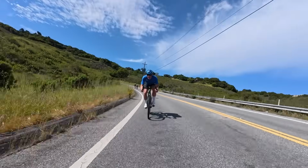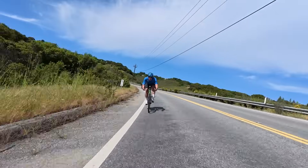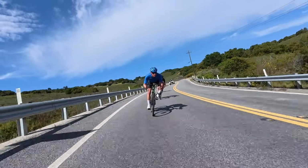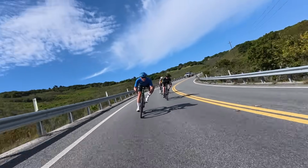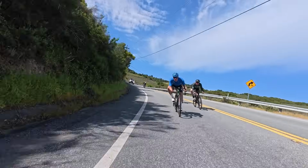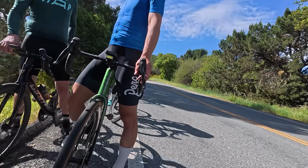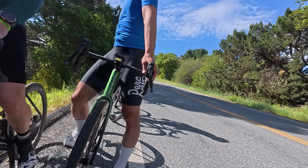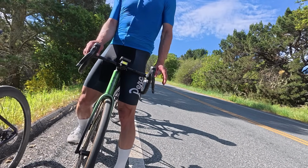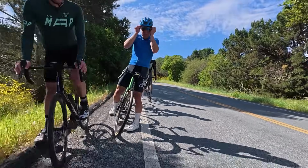We kind of wanted to start with your classic road race geometry, and then obviously boost the tire clearance to 40 millimeter, and then do some nuanced things to add some stability and some comfort to the ride. But we also thought there were a lot of good endurance and gravel bikes on the market that all lean towards the taller stack height, slower handling, and those bikes are great for the right kind of person, but we found there was a bit of a sweet spot where there really wasn't a racier bike that could take 40 millimeter tires. So stack height is maybe a smidge taller than your pure road race, but closer to road than endurance. Front end handling is definitely on the faster side.